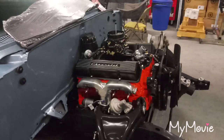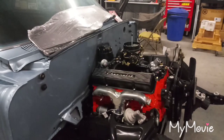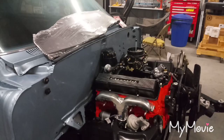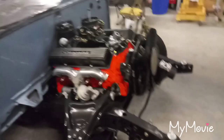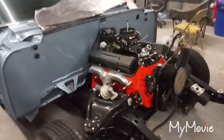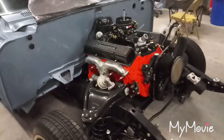Something funky is going on with the driveshaft. It only has two pieces, and the end that would mate to the transmission yoke — that piece is already at the transmission yoke, so there's no room for a third piece. That's strange, because with the last 350 I put in an Impala it was a direct replacement with the driveshaft. I've got to figure it out — might have to modify the driveshaft.